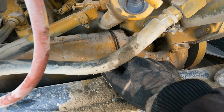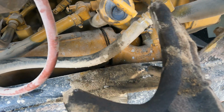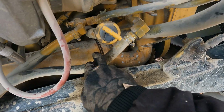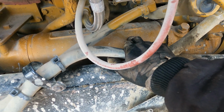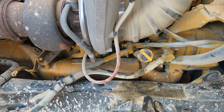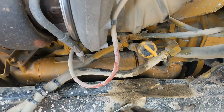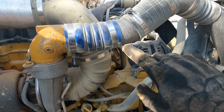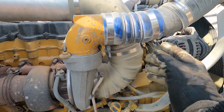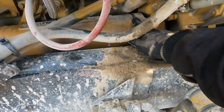Well, these two little O-rings in here don't want to hold water no more when it gets cold. They shrink and expand when it gets warm. As soon as you start it up, it quits leaking. Give it a little time. But I had replaced this last year, and when these go out, it's fun because it fills the entire cooling system full of oil, and sometimes water in your oil. I had to flush all this out. I actually put like 2 huge bottles of Dawn dish soap with water about 7 times, run it, circulate it, drop it out, run it, circulate it, drop it out. It's a whole mess. I didn't film back then, so I don't have any footage of it. You just have to trust me.